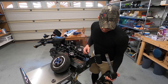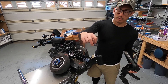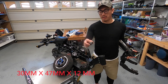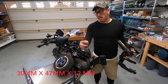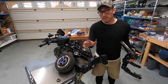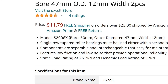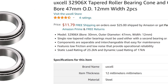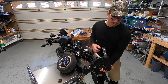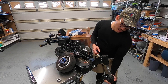Eventually I figured I'm going to have to replace these tapered bearings. I did some measurements with my calipers: the inner diameter is 30 millimeters, outer diameter is 47 millimeters, and the width is 12 millimeters. Based on my layperson caliper measurements, I placed an order on Amazon and the bearings are supposed to get here by next week. I'll see if they're the right fit — most likely they will be.